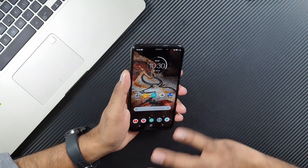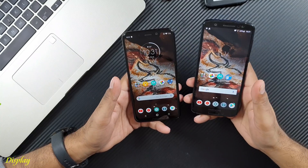The Moto G6 had an IPS LCD; this one has an LTPS LCD. LTPS technically gives you higher resolution, but its overall lifespan is shorter than IPS — though it should easily last three to four years, which is the most you'd use a budget phone. There is a display bleeding issue: you won't notice it normally, but when you open an app and the navigation bar goes gray, you can see light bleeding in from the edges, which is not visible on other phones' displays.